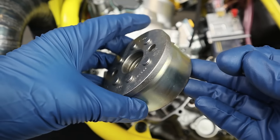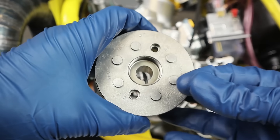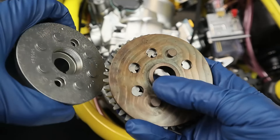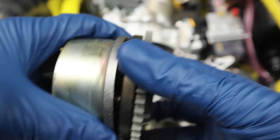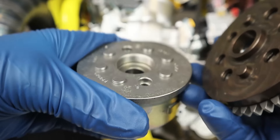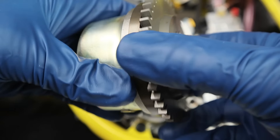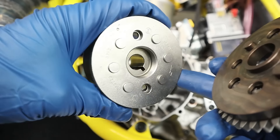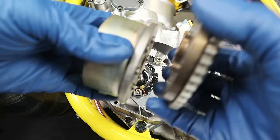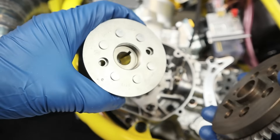The next step is to install our flywheel. If you guys are putting this e-start system on a used bike, the flywheel is already going to be installed — you just remove the nut. The instructions mention that the drive gear has two tabs that lock into your existing flywheel — mine drop in very nicely. Yours might be a little corroded or rusty, so you may need to pull yours off and clean it — probably a good idea anyway, because all that dirt mixed with this oil going through your bearings is not good.